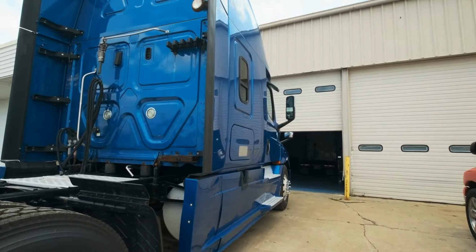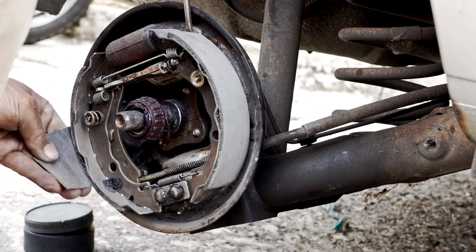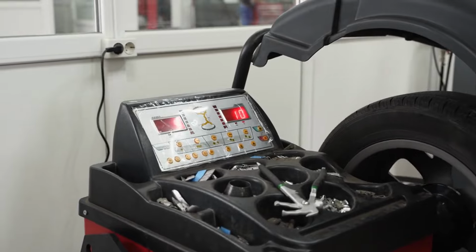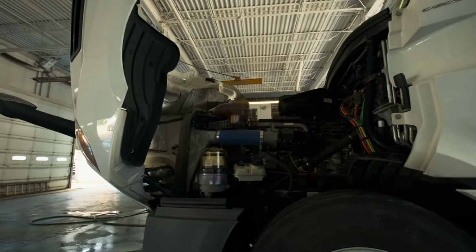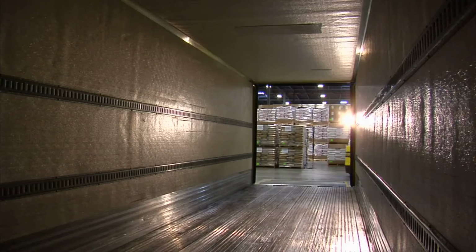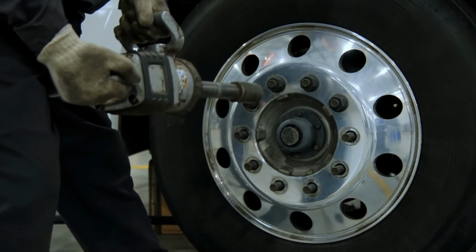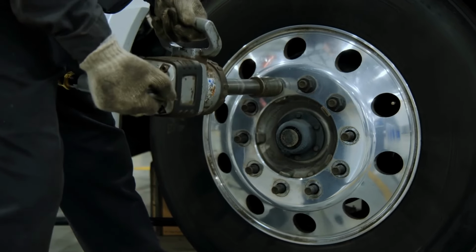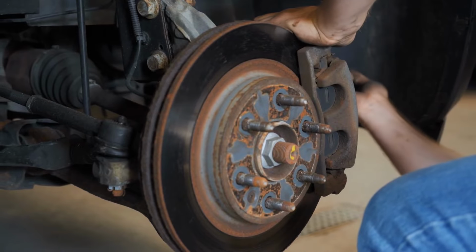Feathering or cupping. Look for wavy patterns or scalloped edges on the tread. Catch uneven wear early before it ruins a good set of tires. Vibration or wobble while towing. A trailer that shakes or pulls to one side usually has something loose. Notice vibration. If your trailer starts to shudder, especially at certain speeds, check the bearings first.